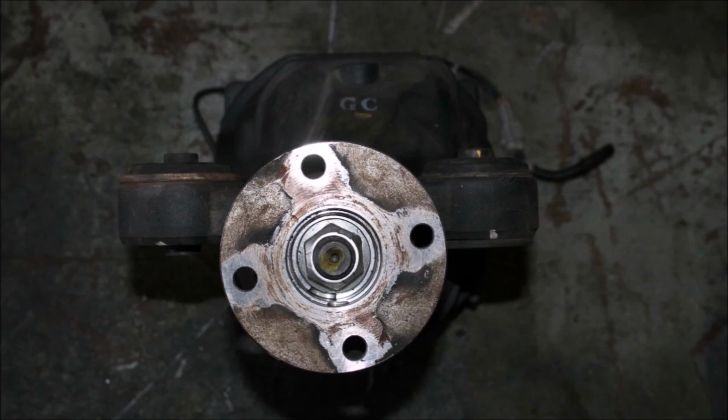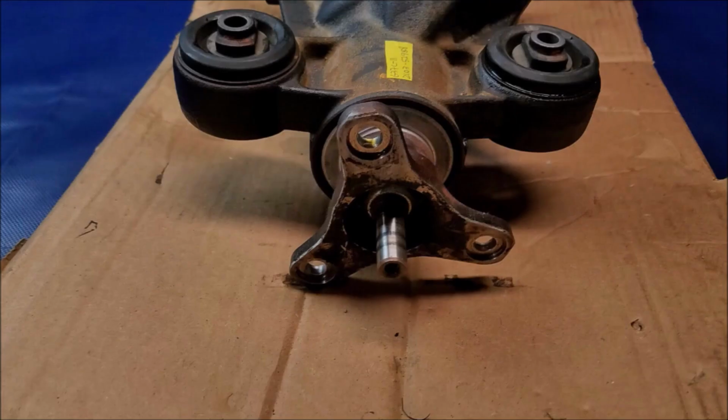They all use the circular flange if it's a manual. If it is an early automatic car, like an 03, 04, 05, it might have a circular flange, it might have a triangular flange. If the car is newer than that, it most likely has the triangular flange, but unfortunately there is not a hard line in the sand of production date means this pinion flange.